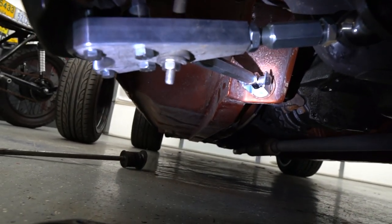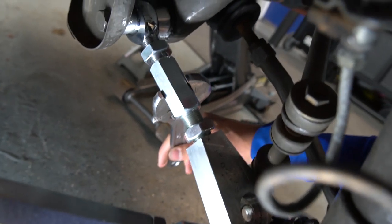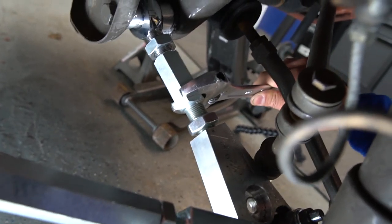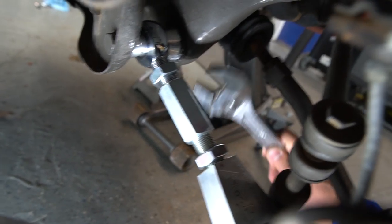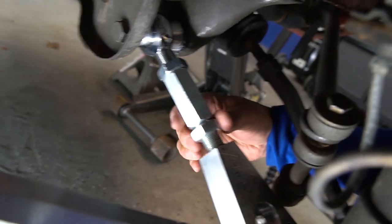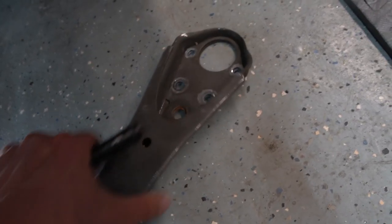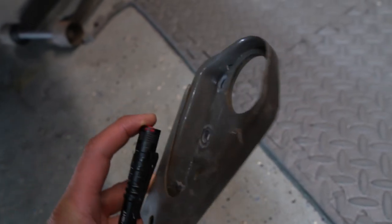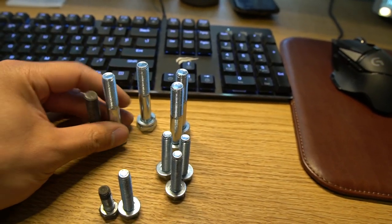Coming over here is a nice machined metal piece which gets mounted to your ball joint into your suspension system. Because one side is counter-clockwise thread and the other side is a traditional clockwise thread, you can simply twist this to expand or contract the lower control arm on the fly — you don't have to unbolt anything like you would on a traditional car. Same thing on the caster side: on-the-fly adjustment. This is why I love aftermarket control arm kits. One thing you have to remember is to get longer bolts — the stock control arm setup is super skinny compared to the new control arm which is much beefier and thicker, so you need longer bolts inside and outside, two on each side, four total.